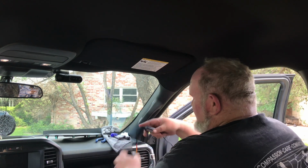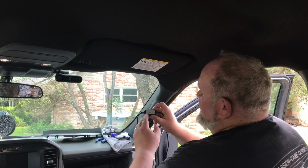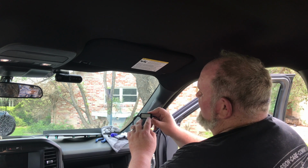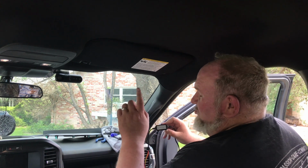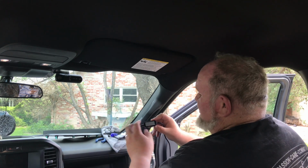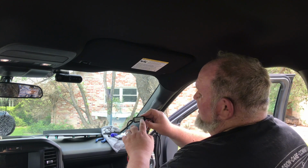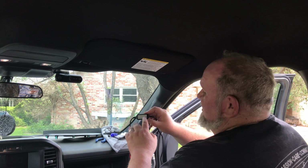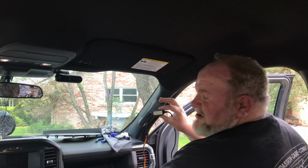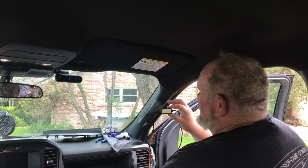And the other thing we have is this little switch, and this little switch is the safety. Down here, it's got 4 positions. It says 11.8, 12.0, 12.2, 12.4. What that does is when this thing is in parking mode, if the battery on the vehicle gets below 12.4, 12.2, 12.0, or 11.8, whichever one you switch it to, it's going to shut the camera off so that it doesn't use any more juice. Right now I've got this one set to 12.2. Really this thing should be able to start on 12 or even 11.8 volts, but we're just kind of playing it safe here.